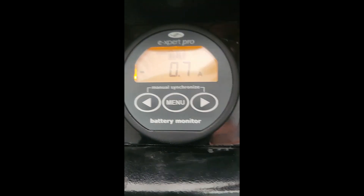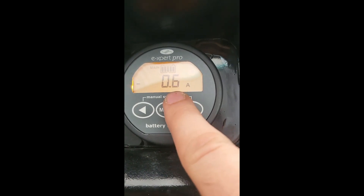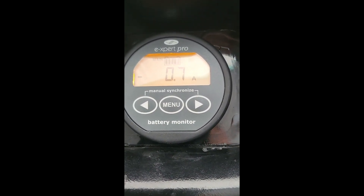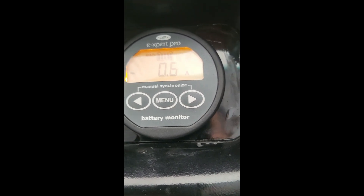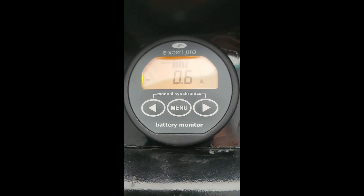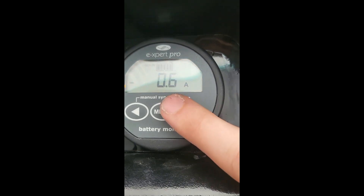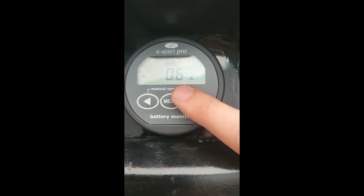This is really cool. It's negative, meaning that it's currently drawing power. 0.7 amps is kind of its default state — that's what's currently being drawn to power things like headlights, turn signals, this little charger here, and most importantly the DC-DC converter that drives all of that. It looks like a higher current than what you'd expect. This number will go all the way up to negative 400 amps at full throttle.